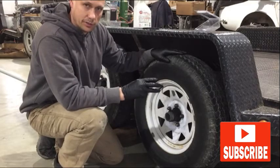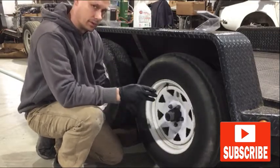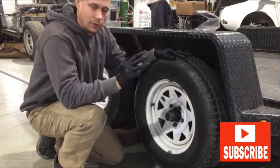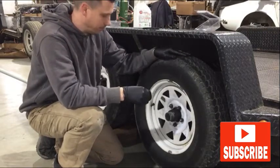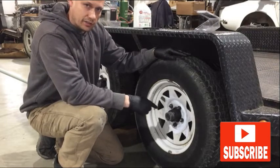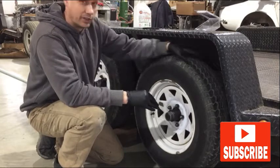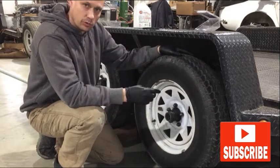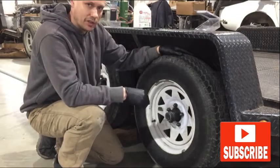I've adjusted the brakes — I adjusted them until there was just a slight drag on the drum. Before I take it out of the shop, I'll hook it up to the truck and make sure that all the brakes actually function and that the wiring is still good. I also went in and added a little bit more grease with the grease gun just to make sure there was plenty of lubricant in there, and I'll come back and check that after the first road trip. Put the rubber plug back in and that's going to finish up this job.